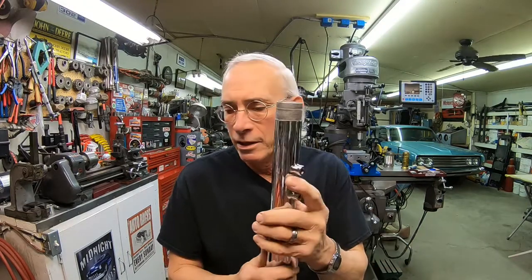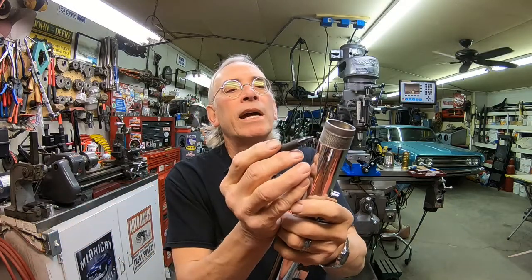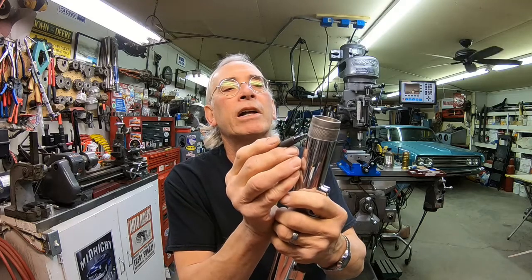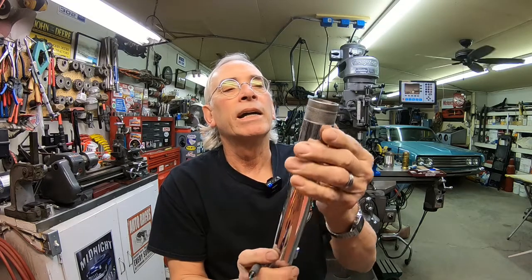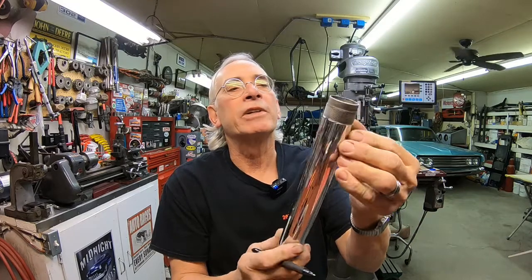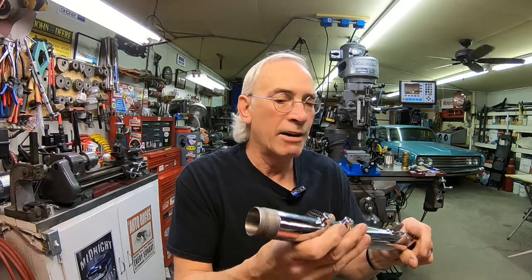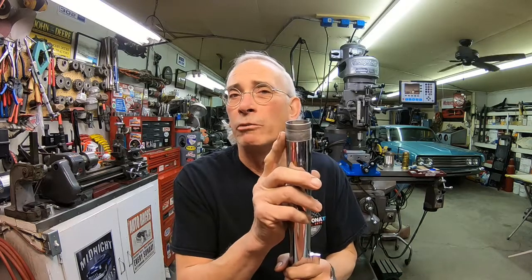Number one, we had some threads here that didn't get covered up when they chromed them, and I had to go in and hand file that stuff to get it back to where I could screw the nut on all the way. And then after I accomplished that, after about a half hour, and it was just on one, it wasn't on both of them,